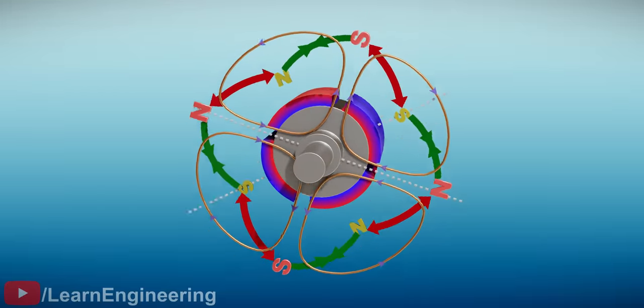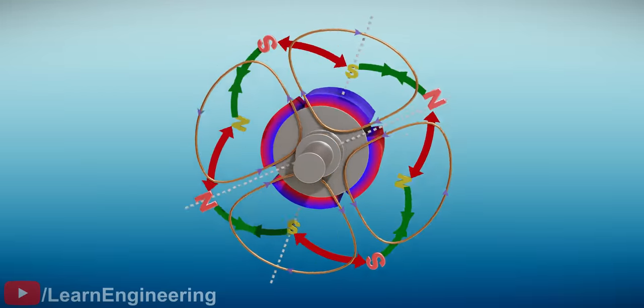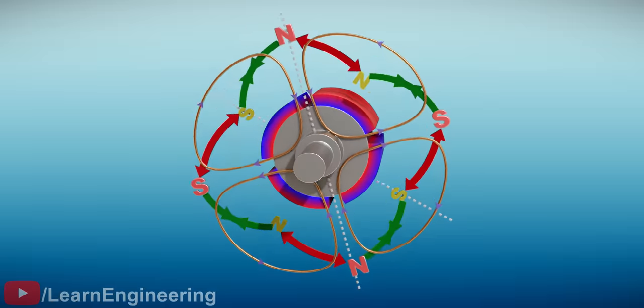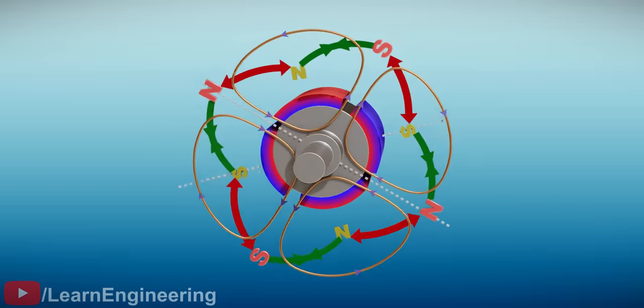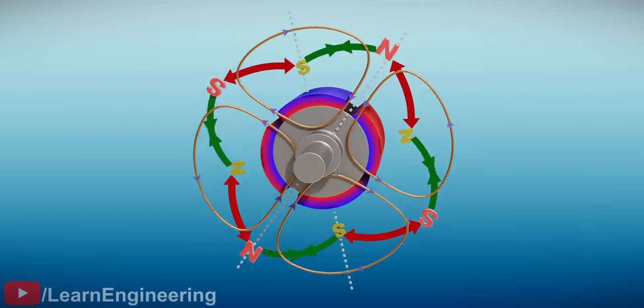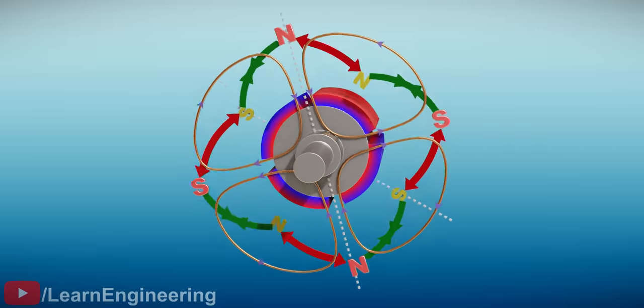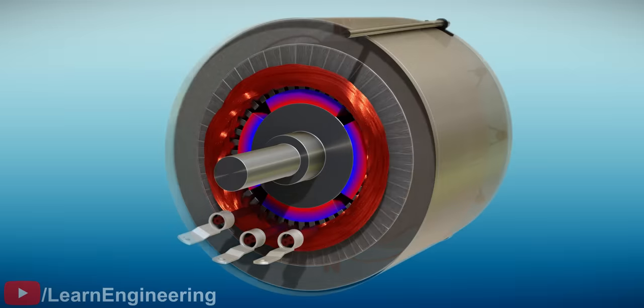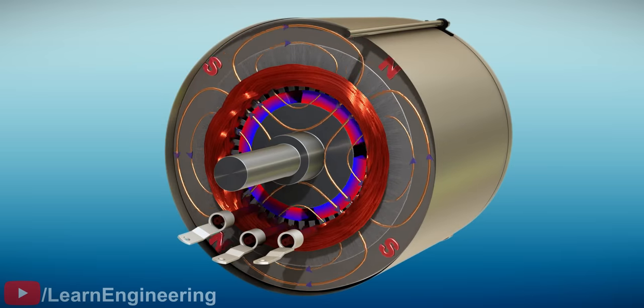This is the perfect angle to start your electric car. Maintaining this angle or further angle regulation is the smart controller's job. In this design, the rotor has no induced current, which reduces the input energy required and leads to higher efficiencies than those of induction motors. Along with higher starting torque, the PM motor also runs at synchronous speeds.